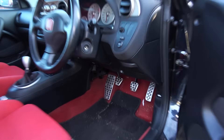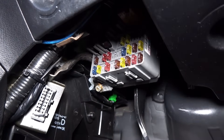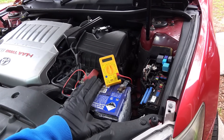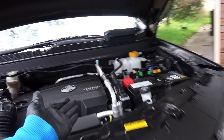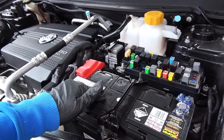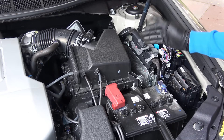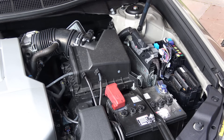If you have another fuse box under the dashboard and need to leave the doors open, be sure to turn all the interior lights off before you begin. This test is called the parasitic current draw test. If you're doing this on a modern car, the test may not be accurate because modern cars have many computers and control modules that are always drawing some current from the battery.